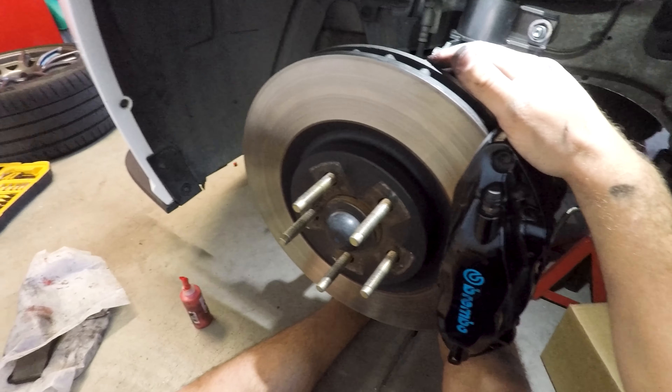And that really is how easy it is to swap brake pads on these front four-piston Brembos. I'm not doing the rears today because I still have the GS1 on the rears and haven't taken those off. In the future, I do want to go with Brembo six-piston brakes from the S550 performance pack cars when I'm more track focused. But as a daily driver and fun car for the canyons and autocross, I'm not too concerned right now — sticking with the four pistons. They brake really hard with the right pads. These G-Lock R8 race pads are really good. That's going to be it for today — just a short maintenance item. More videos coming soon on modifications, track days, things like that. See you guys next time.